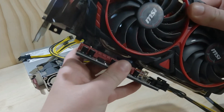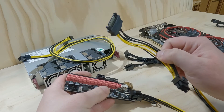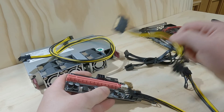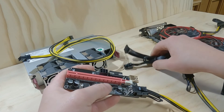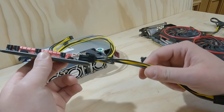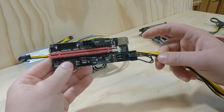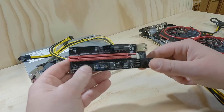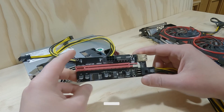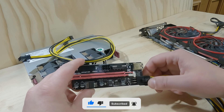The main thing I want to cover in this video: SATA — bad, don't use it, regardless if it's the one that came with your GPU riser or not. Molex — you may be able to get away with it for a little bit, but I wouldn't recommend it. The main thing is that you should always be pairing your GPU riser with a PCIe cable. I hope you guys enjoyed this video. If you think I've missed something, please put it in the comments below. Don't forget to hit that like button, subscribe button, and notification bell, and I'll see you guys in the next video. Thank you for watching, and be safe.